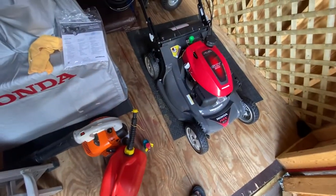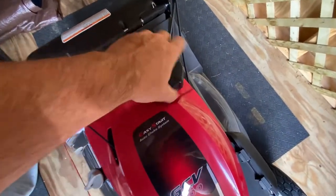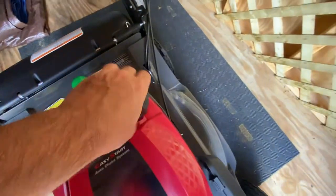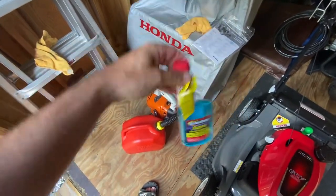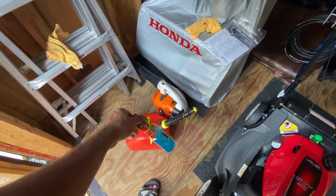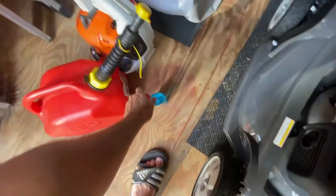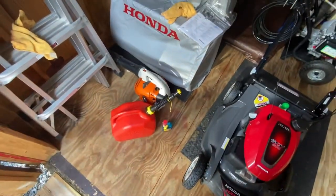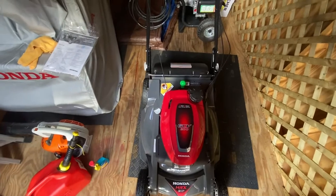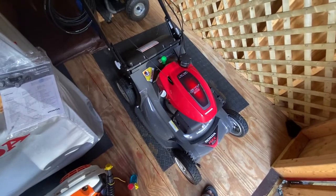Another thing is with the gas — every time I fill up, you'll see this new one. It's a new style and it has a big gas tank. I use the Startron. You guys can use whatever you feel like, but I fill it up about halfway, put the Startron in — the bottle tells you directions on how much to use. Then I just swish it around. So it's basically fresh for months. I've never had issues with a carburetor. This is the new GCV200 engine too.